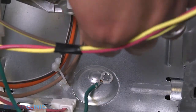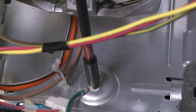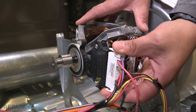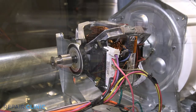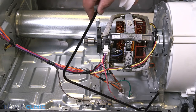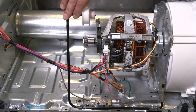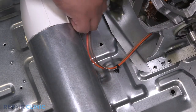Re-thread the ground screw. Plug in the harness to the motor. Insert the end of the arm in the blower housing, then place the arm underneath the retaining bracket. Make sure the idler arm is able to operate the switch. Snap the retaining clip in the bottom of the dryer.